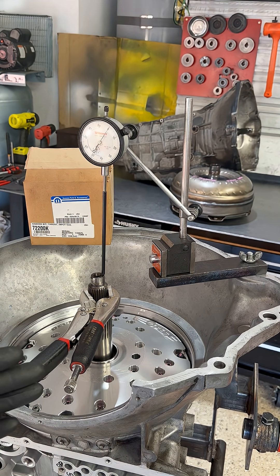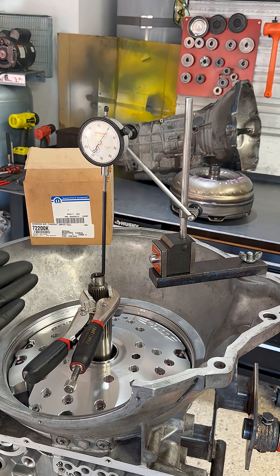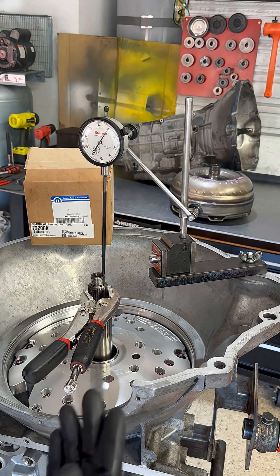When you check your end play with the pump all torqued down to 20 foot pounds, you're going to pull up, you'll hear one clunk, then you're going to pull up further, and whatever that incremental travel is after the one clunk is going to be your net front end play. So I'll show you.